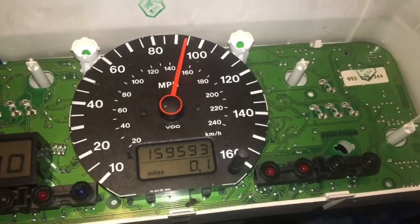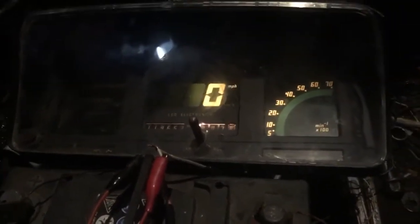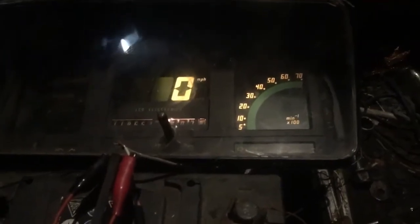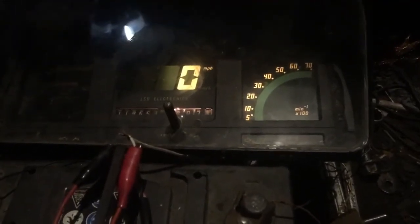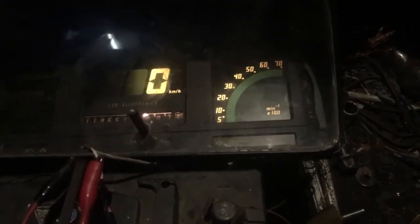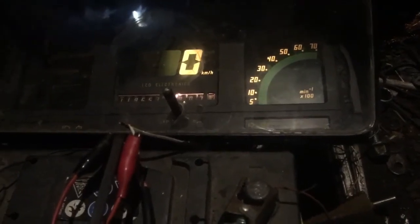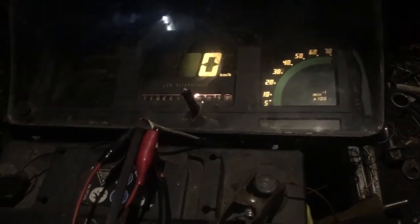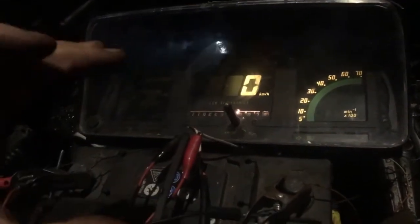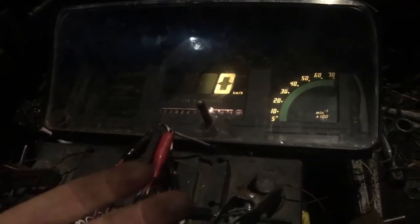There we have a healthy 150 kilometres an hour. So you are probably wondering what I am doing with this setup. The pillar drill is like my gearbox, so I am constantly driving at the exact same speed all the time. Some of them are looking for 16 poles, some for 6 poles, and some for 4 poles, depending on the manufacturer and how they want to set up their gearboxes. If you have more poles it is a neater curve because you are taking more samples at a faster rate. If you have fewer poles you are taking samples at a slower rate.